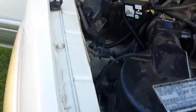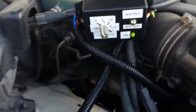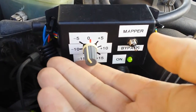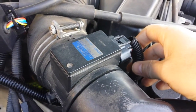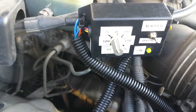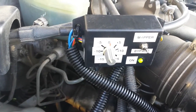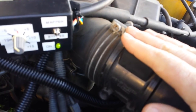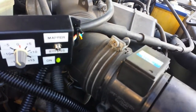Hello viewers, Mezcal here. What we're looking at today is this device here, which has been fitted directly in between the mass airflow sensor and the computer. Basically what it's doing is fooling the computer into thinking there is less air entering the engine, therefore delivering less fuel.